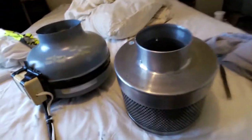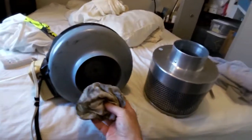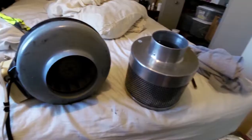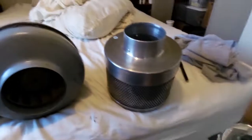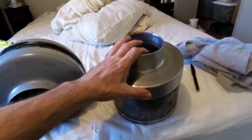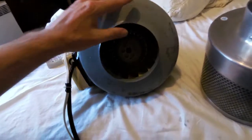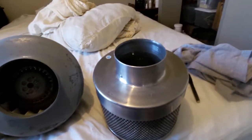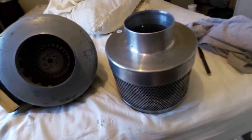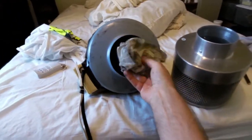Definitely more serious of a problem than I originally thought. Just look at how black that is — definitely that dust would be going right into your air. I'm not going to bet that carbon dust is safe to breathe in; nothing's safe to breathe in. But if you're using one of these things, make sure to post-HEPA filter it always, because they are putting out a lot of carbon dust. And that's just what's attached to the fan — never mind what it's doing to the air. So it's cleaning the air of gases and odors, but it's putting carbon dust in, so that's no good. Always HEPA filter your can carbon cartridge filters, or you're going to get this stuff in your air.